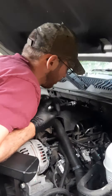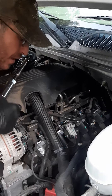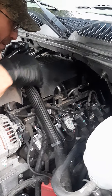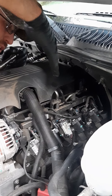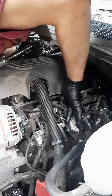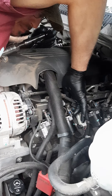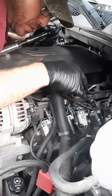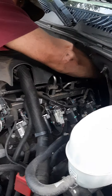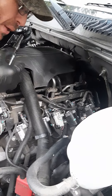The sensor is back here on the driver's side rear. It has a two-wire plug. You reach way back in there — you can take this cover off if you want, but you don't have to. You'll feel that plug sticking straight up and down, vertical, and it's got a clip on it. You reach down with your finger, tucked in there real tight, and just pull up and it'll come right off. The clip on the oil sending unit plug is just like this coil pack clip — reach down in there deep, find it with a single finger, and pull it up.